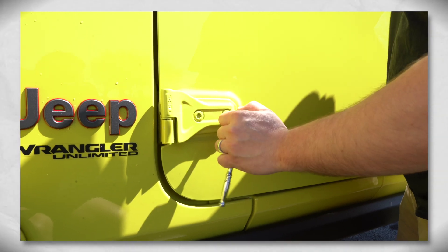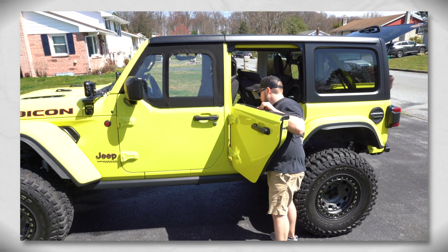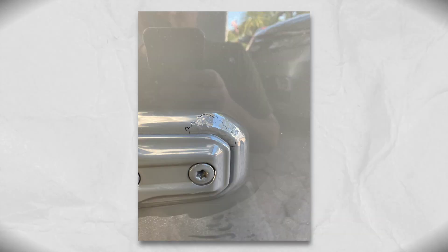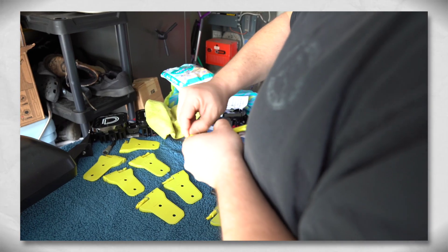I'm not doubting anyone, because if you run a multi-billion dollar company, those little expenditures can really add up when you're producing a ton of these vehicles. Overall, we went over a couple of things today: exactly how it happens, what chemical process causes the corrosion, where we've seen it in the hood hinges, door hinges, and tailgate hinges, and then what to do if yours is happening. So how to address galvanic corrosion on your Jeep, how to approach the dealership — bashing Jeep on comments, forums, or Instagram is not the way. Be polite, be respectful, but push the issue if you have to. And we've gone over how to fix it — painting both sides of the surface will work. We did it with our JL half doors and they mounted up beautifully.